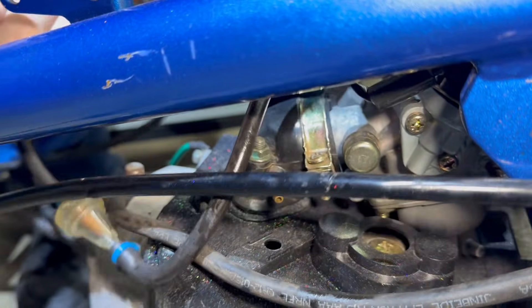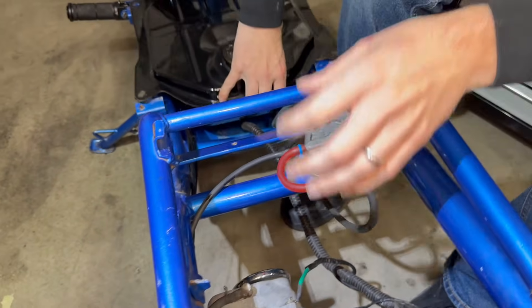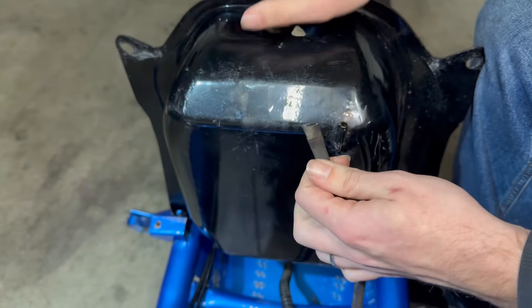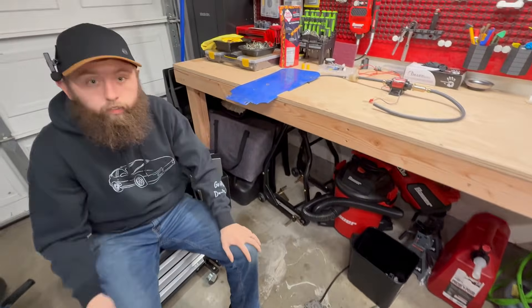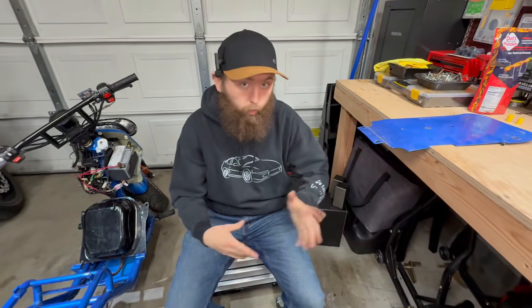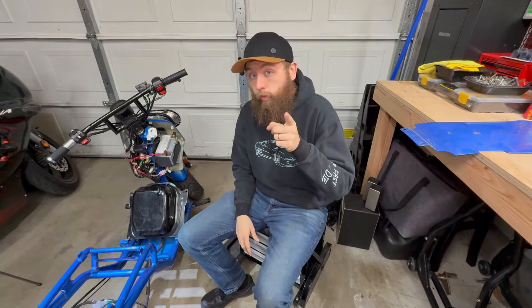That's where you feed in for your usual pump. All I've got left is the line from the tank. I've already unbolted my tank, so I'm just going to lift this up — and there you go, that's everything. It might drip some fuel. And if you have an evap system like most of these newer scooters do because of emissions, it's even worse — a whole new canister and ten more lines. We'll be making a video on how to remove that too.